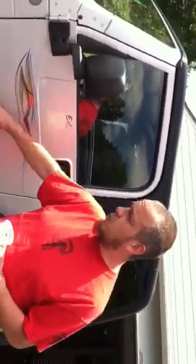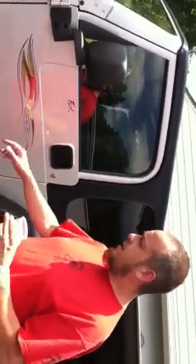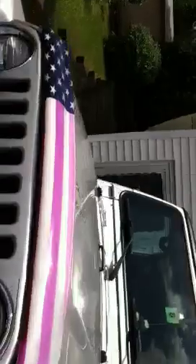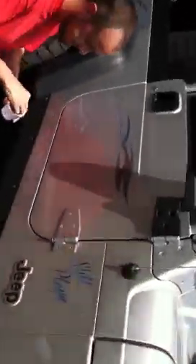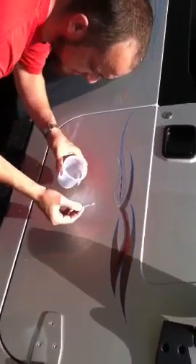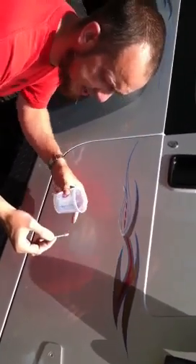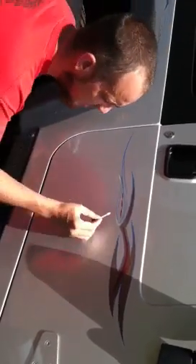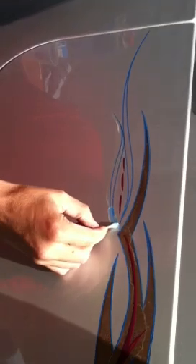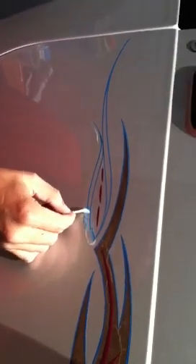In this instance it worked because it's a stock paint job, and now we're going to show you how to do it. This is what it looked like before. On this side I've already applied some on there. I'm using a Q-tip and the Easy Off in a cup. You don't want to spray it right on here because it's very dangerous to the paint job. So I'm going to sit here and rub the Q-tip with the Easy Off — and look how it just comes right off.